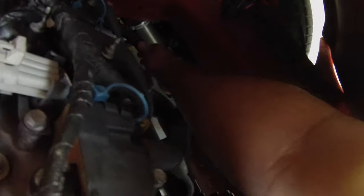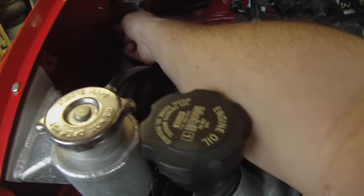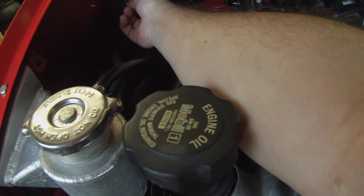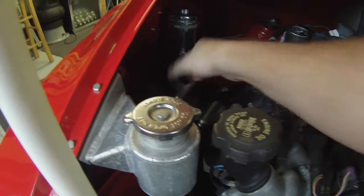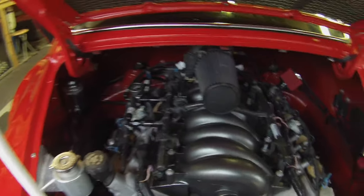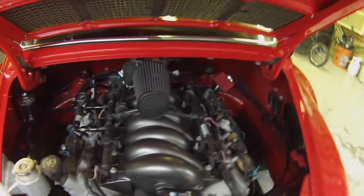This Siamese that you see here, where this comes in, that's the fill from the fill tank. The fill tank goes to a shortened Mishimoto overflow tank. This is also from the steam tubes in the back of the motor. Steam tubes are blocked off in the front, but the ones in the back are live.